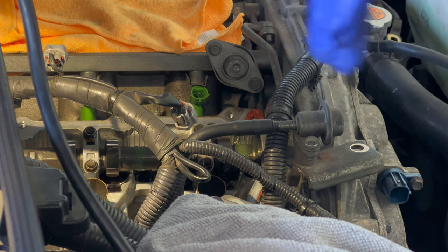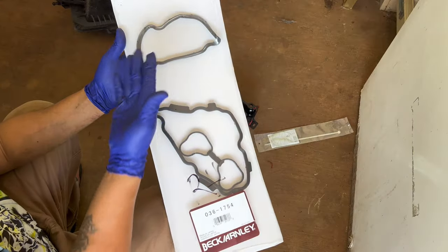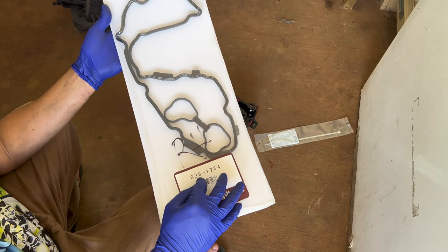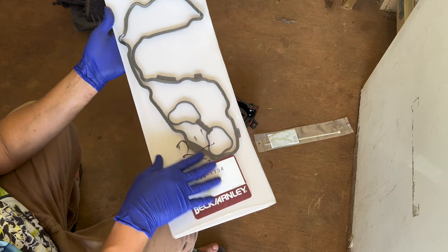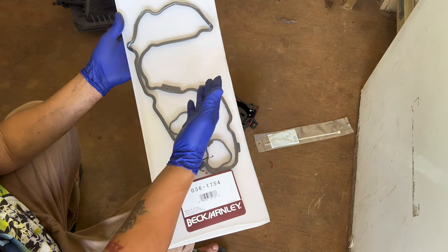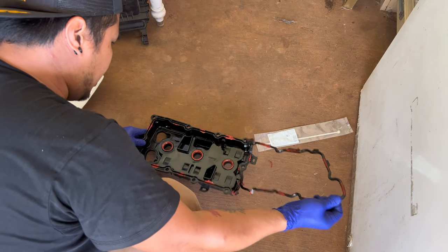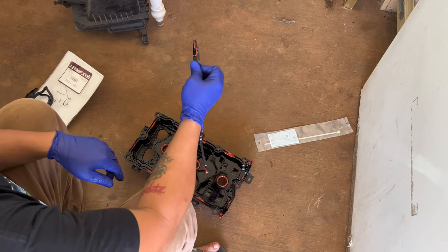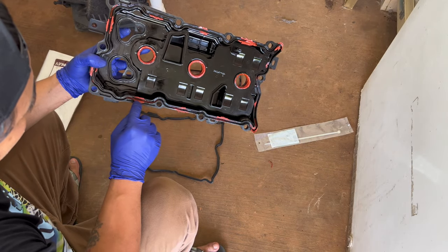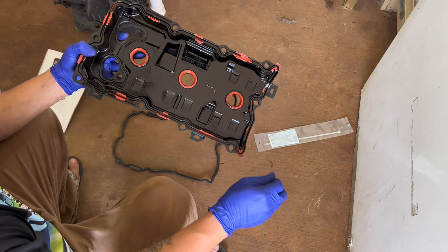Above the cover, you can see there is some RTV that was used. We're going to scrape this off so we can put new RTV. This little part right here, you're going to have a hard time unscrewing or breaking it loose. Best recommendation: take out the cam position sensor right here — when you pull it out, you have a little more access to that bolt, as well as the two other bolts. This screw near coil 6 is hard to get to even with an extender. Don't jump the gun and do one side — do both at the same time. When I take this out, we're going to give it a good clean — wash it down, hit it with some carb or throttle body cleaner. Then we'll put the sealant, let it dry a little bit, and put it in.